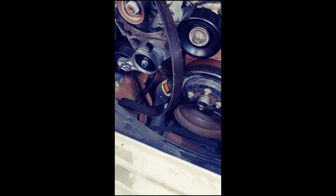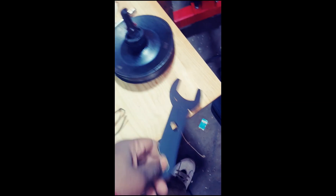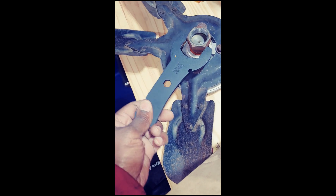You got your guy CD Shine here, working on the 96 Chevy pickup truck. The fan shroud uses four 10 millimeters — take those off and get that out of the way. You need a 36 millimeter breakaway tool — I don't know the exact name — to break away the fan clutch on these jokers.